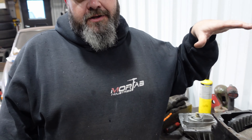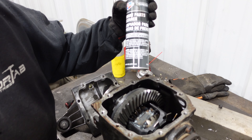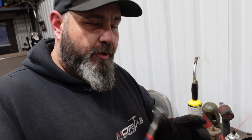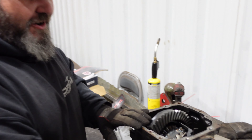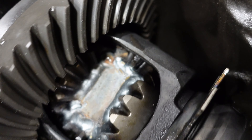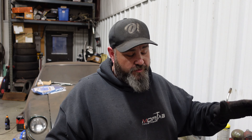So now we're just going to let it cool. Once it's cooled off, we'll hit it with some brake cleaner and make sure there are no boogers on the ring and pinion. Once that's done, we'll put it back together, fill it with fluid, and put it in the car. I hope that clears up a lot of the questions about welding the diff. Once it's cooled off, I like to clean it out with brake parts cleaner and then go through it with a magnet just to make sure you get all the metal particles out. I always recommend to the customer that you change the diff fluid after the first run — get it broken in, then change the fluid to make sure everything is clean.